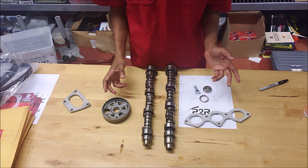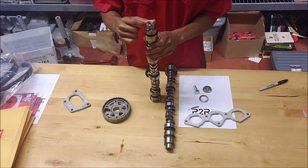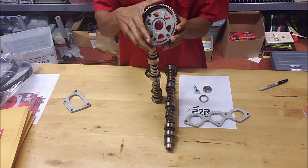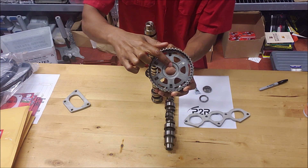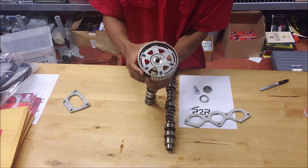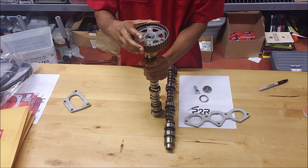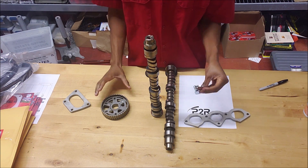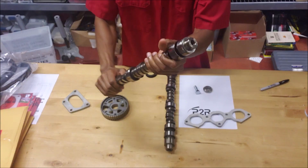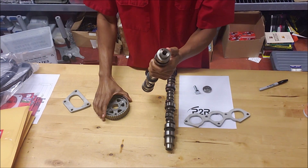I get a lot of questions on exactly how to install the camshaft spacer, so I wanted to give a quick example. On a J series — or any engine in general — you have a keyway which holds the cam gear on. On a J series, the keyway is actually built into the cam gear itself, so you'll put it on and it keeps it locked in place. However, if we try to install this into a first-gen engine we're going to run into issues with the timing belt, so we make this spacer which pretty much slides onto the base of the camshaft, which adds enough length so that we can line the gear up properly.